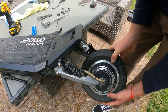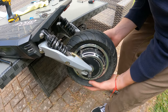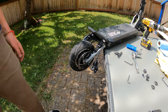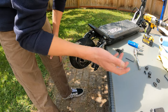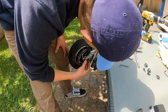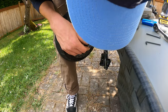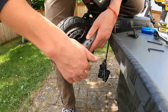Drop the wheel back down and slot it into the fork. Install the locking rings on both sides. You can choose to skip the fender bracket if you don't use rear fenders. Put the locking ring on the left side, then the right side, making sure each is properly slotted in. Twist down your nuts — don't fully tighten yet — then repeat on the other side.